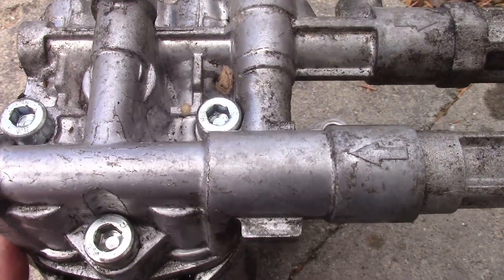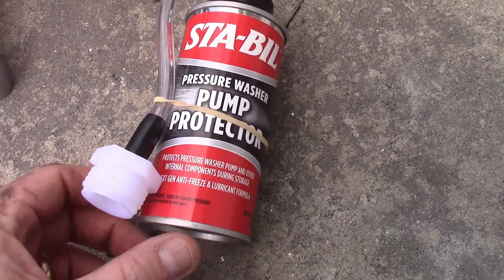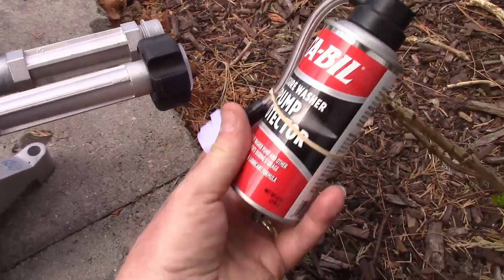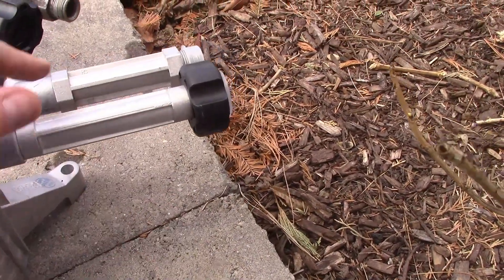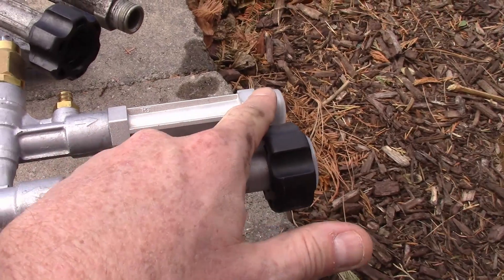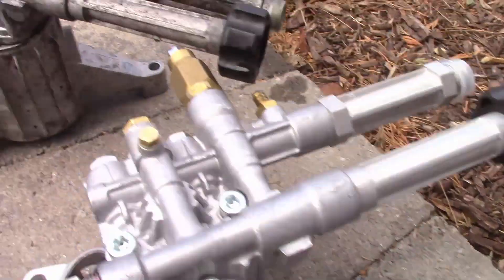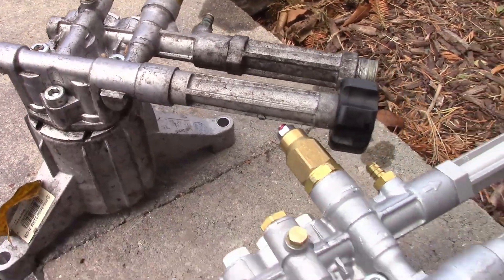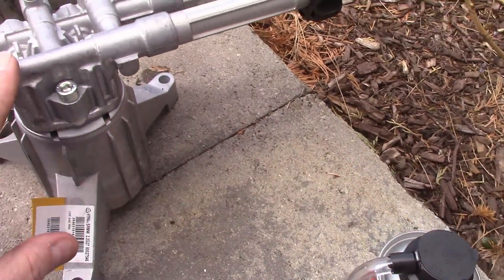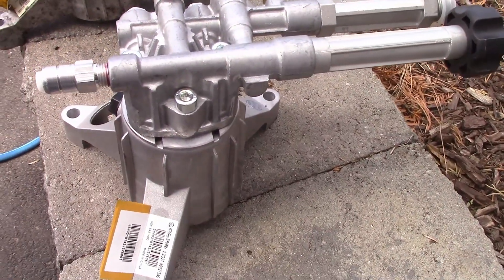I'll show you how to prevent this from happening. This is the pressure washer pump protector from Sta-Bil — they make the fuel stabilization additive for garden equipment you put away for the winter. This connects right into the hose portion, so you screw it in here, press the button, and you take the pressure washer hose off. Essentially, you spray that stuff and it fills the pump cavity; when it comes out the other side you've evacuated all the water and all you've got is this protectant in there. It won't corrode and it won't freeze — freezing may have actually cracked the aluminum here as the ice expanded. It's only four ounces, about seven or eight bucks — obviously cheaper than a new pump — and you should get at least two uses out of it.